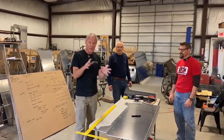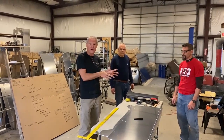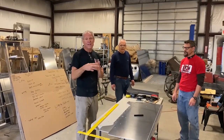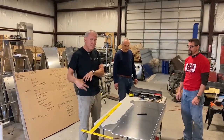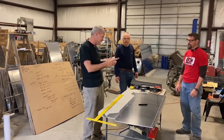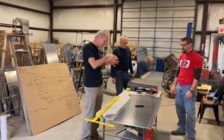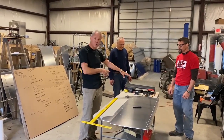This video is going to be for the VW Beetle, and it's going to cover placement of optional rear speakers. If you have a Monsoon or a regular stereo in a Beetle, there are some limitations to the types of speakers you can put in the bottom corner of the front wall. Andy has fantastic information about not only the limitations of the speakers, but the types and measurements that will clear all of the interior trim pieces.